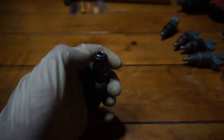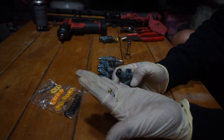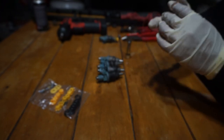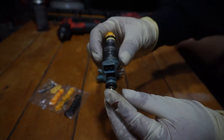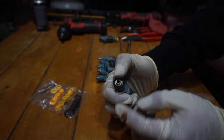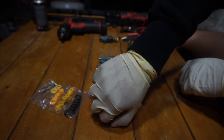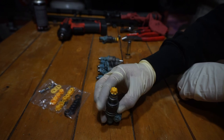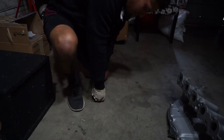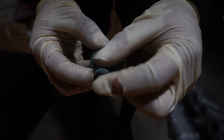After your injectors are all cleaned up you need to put the filter in. Here's a new filter — put it inside the injector and turn the injector over. On the ground or a flat surface, press down hard and the filter will eventually go in because it's tight. Just press down firmly and the filter should go in — you'll hear a pop when it does. Make sure it's flush with the top of the injector.